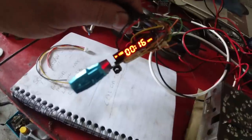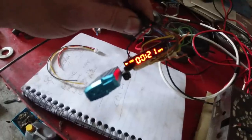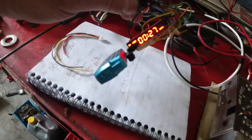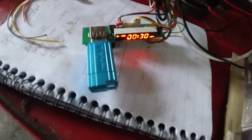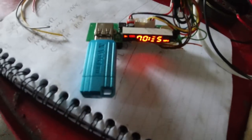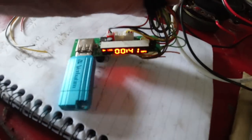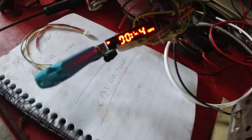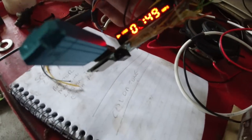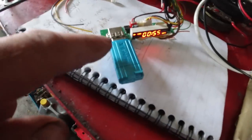I had a spare module lying around - I think this is Lee's unit. It's an MP3 standalone module basically used in radios and public address systems and background music applications. They're not expensive. What I've done is paralleled across the buttons of it - the fast-forward, the rewind, and the mode switch. There's a USB stick there; you can put an extension lead on it and bring it closer to the console if you want.